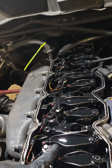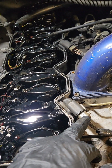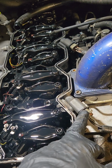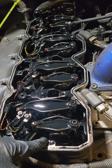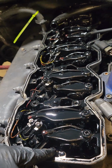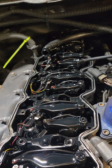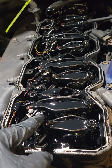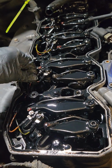To do that, you have to pull the wires off of your injectors and unplug your bank connectors, because each one of these controls 2 injectors. So this is your bank. And then there's bolts here. Let's see, where are they all? I know there's a bolt there, and seems like there's a couple others mixed along. I know there's one here and one on the other end. That may actually be all of them. But these right here are 8mm. Be very gentle with these. And also remember which wire goes where.